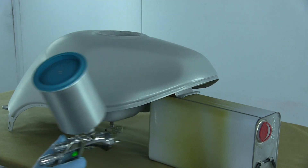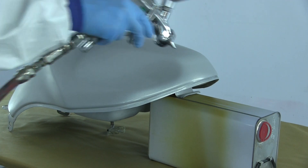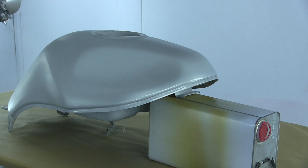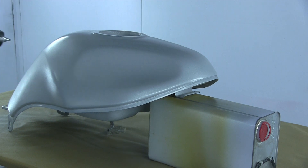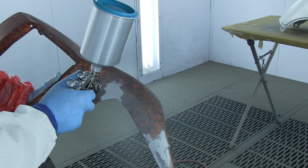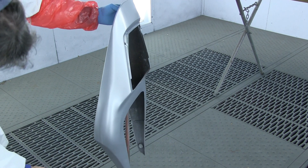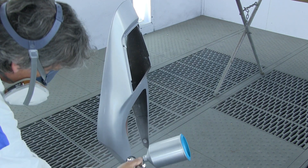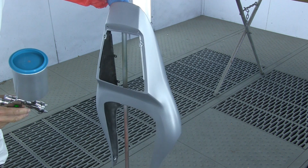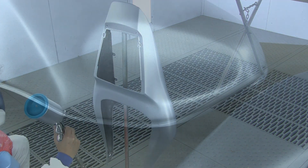I'm going to come in and spray a couple of coats — you don't want a one-coat wonder, just build it up over 2 or 3 coats. This is a 1.3 setup gun I'm using here, and I'm spraying medium coats — not light, not heavy — with a nice wide fan pattern, just covering the primer with the sealer. The sealer has really really good coverage, even over spot repairs. I've got three coats on here; putting three coats just to make sure I completely neutralize all those imperfections and repairs done on the bike, giving myself a super clean silver base coat.